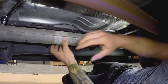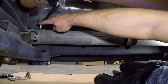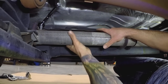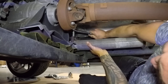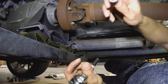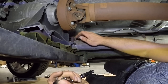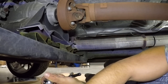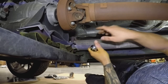Now we have a nice clean cut. We can go ahead and take off the clamp on this side - it's 15-millimeter nuts. My truck being a 2014 with higher miles, these bolts did snap off the clamp, but that's not a big deal since those clamps are about three dollars at the store. Let's get the other bolt off - I'm assuming it's going to snap as well, but we're just trying to get this pipe out of here.